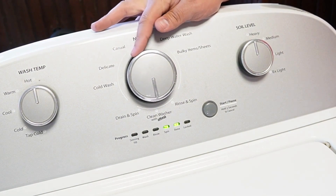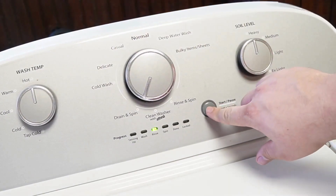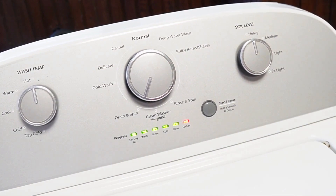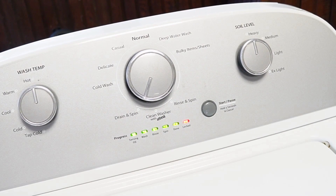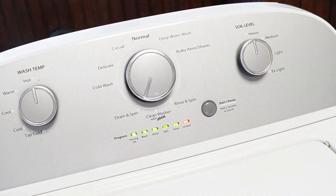Once you're in this mode, turn the knob clockwise four times. The rinse light should be the only one illuminated solidly — this is the recalibration mode. Once you press the start button, the door lid will lock and it will begin a series of tests and operations on your washing machine. All these tests take approximately three minutes. As the recalibration mode runs, every part and process on the machine will be ran and the machine will physically reset all components to a default state, allowing them to run at an optimal level. This is a must-do when parts aren't working right or the machine doesn't know what state it's in — like after replacing the shift actuator or a control board. During this time you're going to hear all kinds of noises from the machine, and that's totally normal.